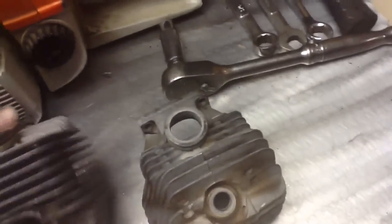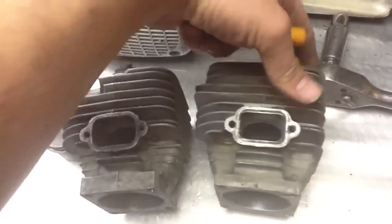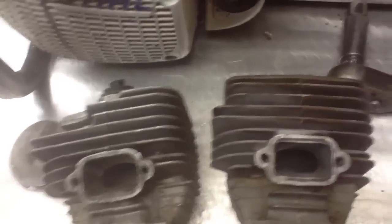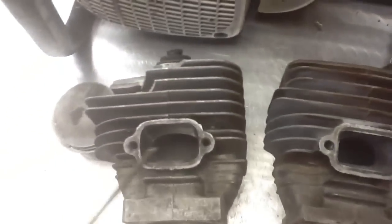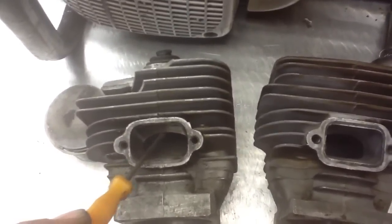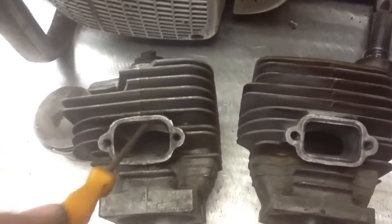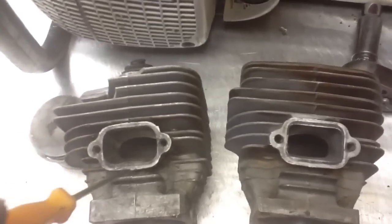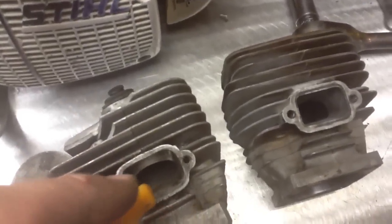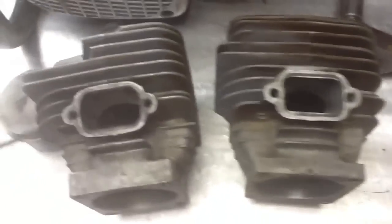You're going to do the same thing on the exhaust side. What I call the reverse megaphone effect: you want to make sure that at the point of exit of the cylinder wall is where you have the most air restriction — everywhere from there can open out. That way you know you're getting the most air in and the most air out. It doesn't have to have a polished mirror finish, but you want it smooth. You can see the difference between the two.